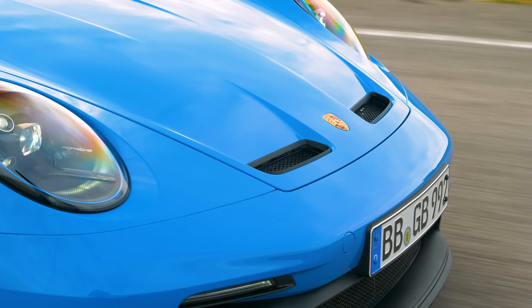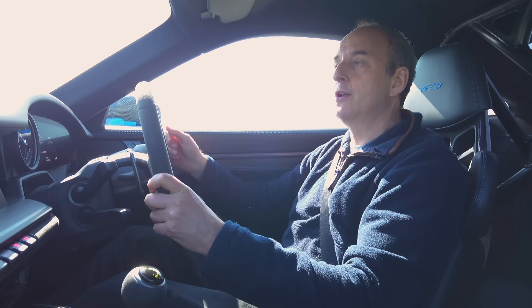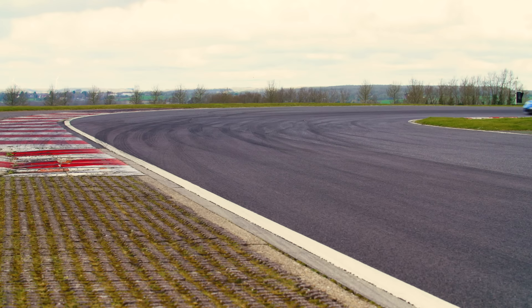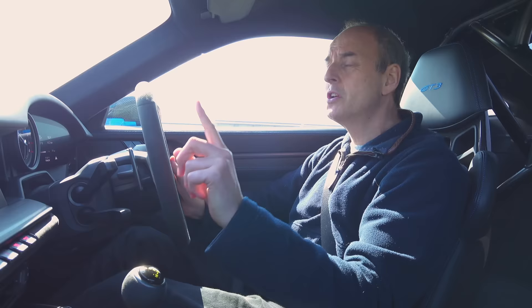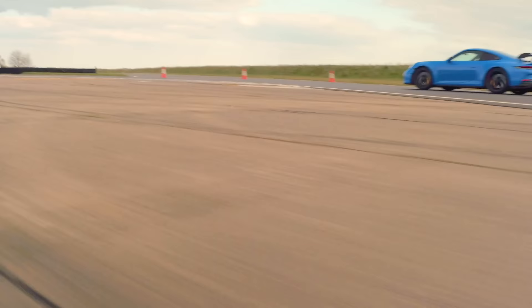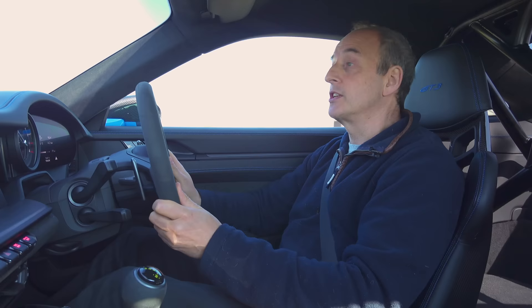Mainly for the good. There will be people who think this car is less playful as a result, because to be honest, it's much more capable. You can't muck about with it in the same way — you can't just chuck it in and sort it out. The car just wants to go fast. The double wishbone front suspension brings a completely new level of precision. Out on the road, I'm not convinced that with this setup — which is twice as stiff at the front as the previous GT3 — it might actually be a bit too hardcore for people who want to use these cars as daily drivers. I'm hoping the Touring version will have its suspension backed off a little bit to make it more usable.